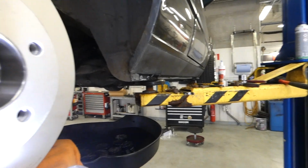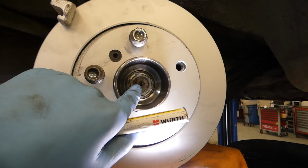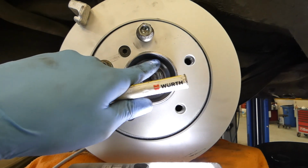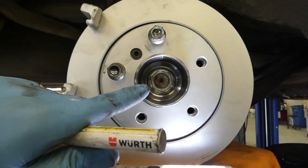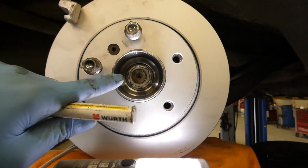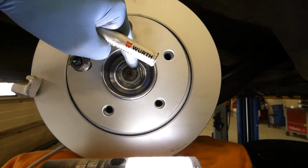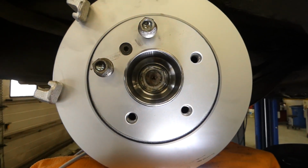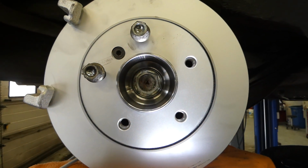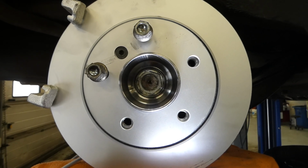So I just tightened the nut. It's 210 Newton meters or 155 pounds per feet. Since the E30 has a different lock thing, the axles on E36 and E46 have a notch here where you can secure the nut by banging the end in. So I have no securing things, so I just put Loctite, and I'm gonna mark it to see if it moves over time. Check it again next Saturday or something.